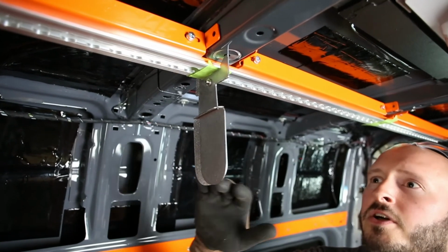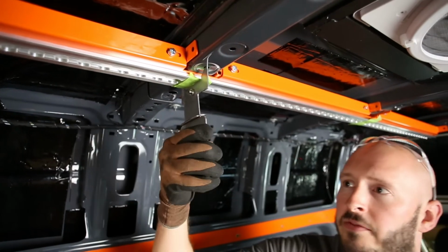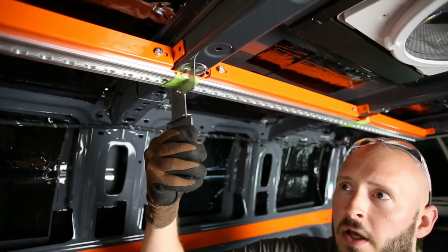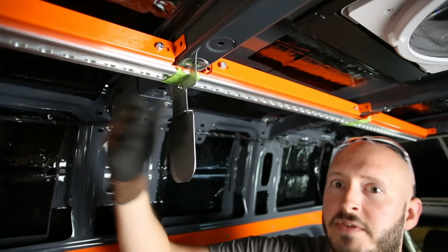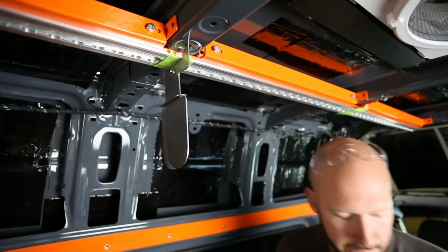Again, make sure you're never drilling any holes and setting your bolts without the tool being in place on the rib that you're working on. You only move to each next rib when the tool is locked in place to drill your bolts.